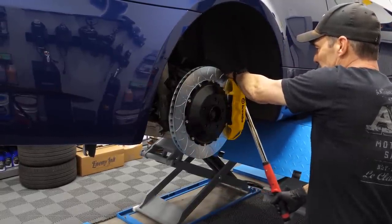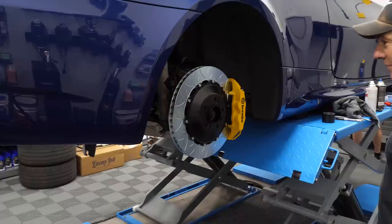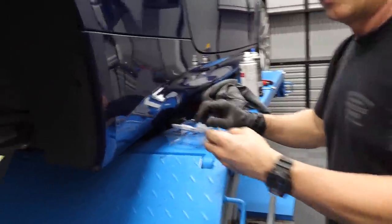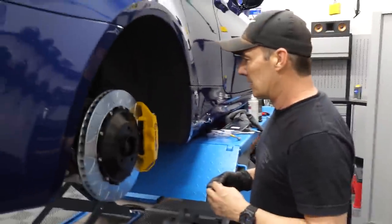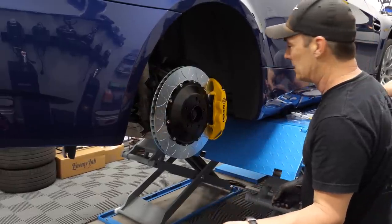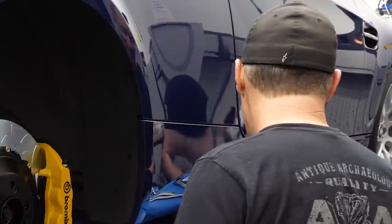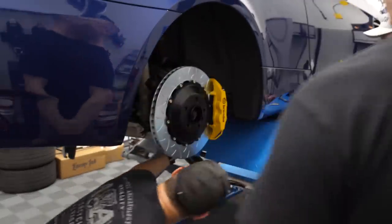I would literally probably be doing this stuff until July — what we just did in two days. We did a lot. Last thing is the brake line — where's the brake line on this one? The brake line is right here — there's the feed. It's got a little different fitting. Instead of a hose with a banjo fitting, it's got a fitting with a crush washer. Next time we'll do the exhaust. So the bleed procedure is the same — start with the outside.